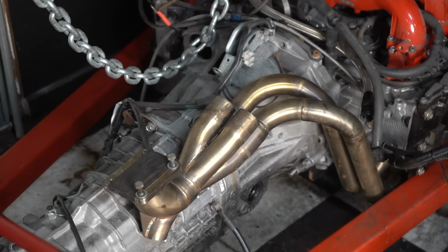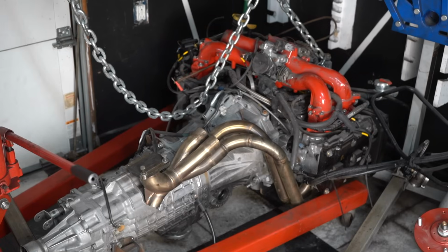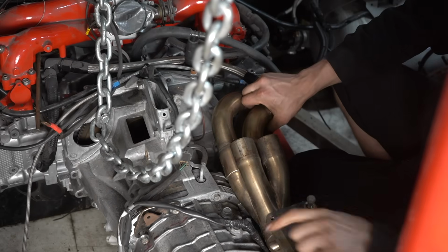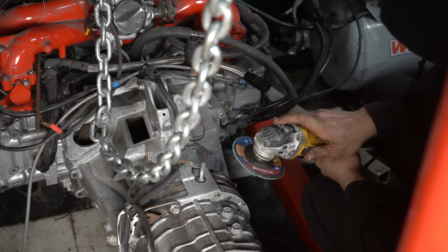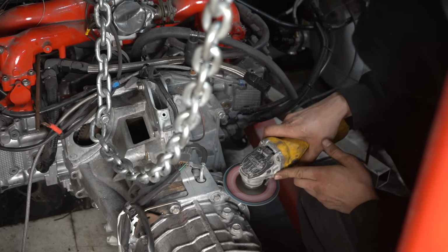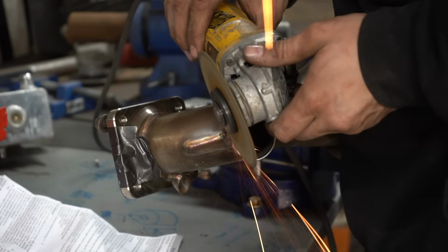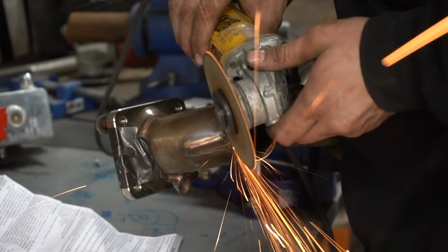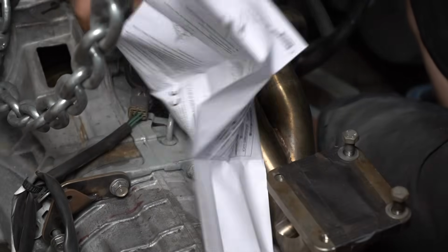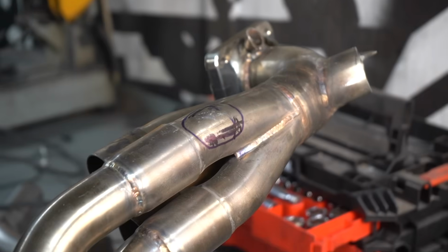With the chassis off at powder coat, I can use the time to finish small projects I put off, just like the header. The 6-speed transmission is way wider than the original transmission in the car, and as such, the header rubs against it. To gain some clearance, I'm starting where everyone would, grinding the transmission. With the transmission and wastegate tube clearanced, there is now a paper's worth of gap. While probably okay, it would make the transmission extra hot, so I'm cutting the header now.